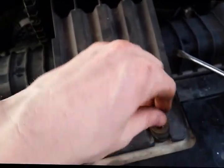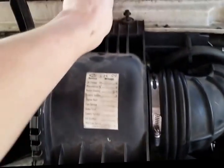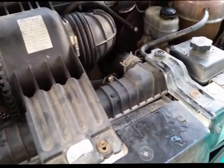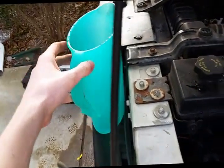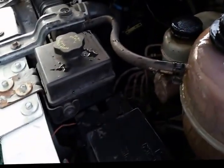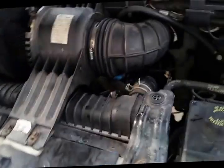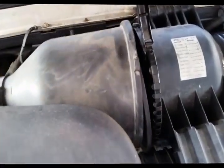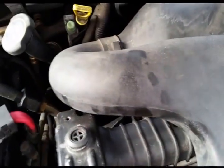Alright, we've got this next piece on there. Remember the sensor in the back that we unplugged — we'll want to put that back together. With your screws you want to hand tighten as much as possible and then use the 8mm socket on all four of them. Don't want to strip the threads out, so make sure they're lined up correctly. On this 5.4 liter 2000 Ford E250 engine there is no radiator cap to fill from, so we went to the reservoir tank and put in 3 pitchers worth of water. We're not seeing any leaks down below yet, but the real test is when we start it up and let it run — it's a heated enclosed system, so as the heat builds so will the pressure and any leaks will be evident. We're putting on the last piece with the air filter — get that in there, put on the clamp, make sure it's tucked in. That'll conclude the repair; now we're just going to do some diagnostics to make sure we didn't miss anything.